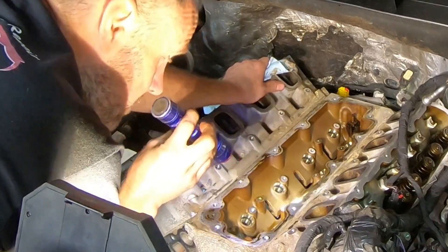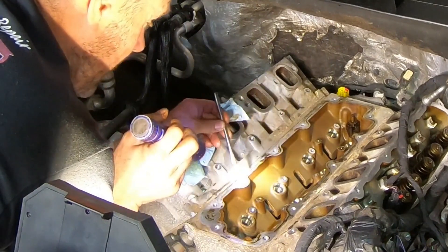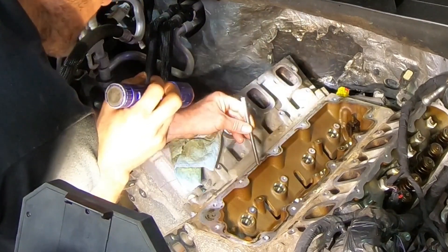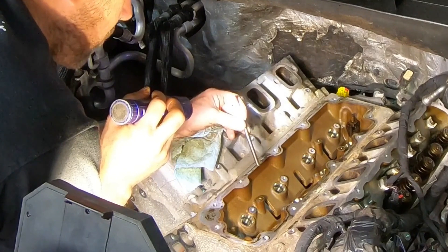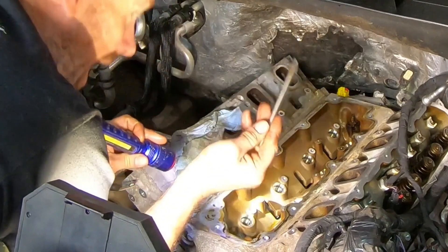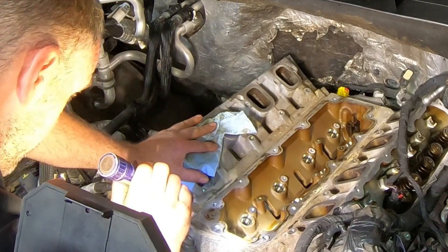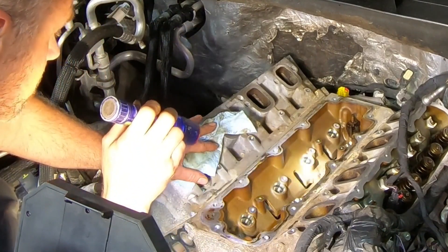There is a major problem here as far as releasing these lifters goes. This is the tool that I would use — it's one of my medium-aged, not fully refined versions — but it's got a 45-degree cut and normally you would go straight into a little oil tower that sits over the lifter and you'd be able to hit the side of the lifter to knock free that unit. If you've done this process and that's why you're watching this video, feel free to leave a comment. Which tool do you have? Do you have the modern one with a real nice shiny finish, the old original OG tool that's actually made out of a push rod, or something in between? As far as releasing these lifters goes, I certainly can't use this technique — or maybe even that technique. I might be able to come up with a solution, but I think it would have to be with the lifter in a certain position, because the lifter actually lines up with that hole in the side of the lifter perfectly.